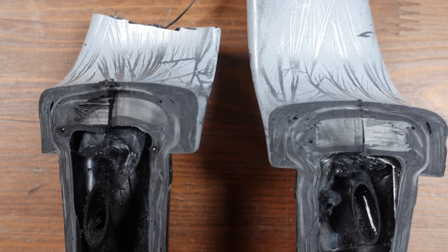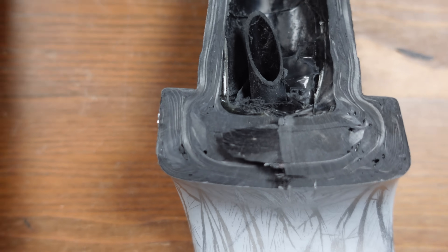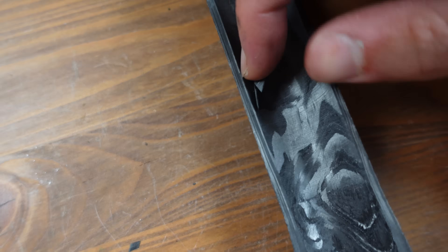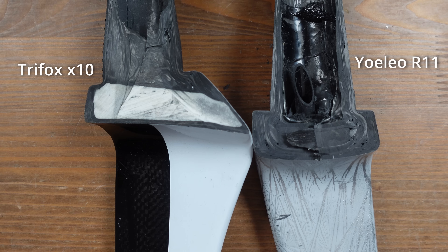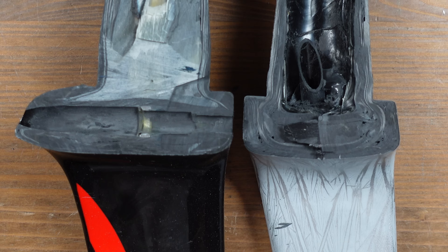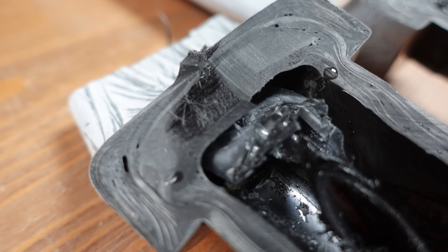Let's move over to the forks. The Yoleo R11's forks are looking pretty good. As this frame is disc brake, it's solid carbon all the way through the fork — no room needed for a front calliper bolt. You can almost trace the direction of the carbon curving around the crown race, which is noticeably thick. Inside the steerer tube there are some flaky bits of carbon — a random layer before the actual bonded carbon takes over. On comparison, the Yoleo forks are superior to the Trifox X10, which houses a mysterious white chunk — possibly resin — and bears a rather thin carbon layer on the outside. The Pinarello fork is wider, probably to accommodate the long bolt needed for rim brakes, yet in terms of carbon thickness around the crown race, both the Yoleo and Pinarello are in the same league. Rob said: the fork junction and crown race looks very solid — possibly overkill for a performance bike, but in terms of strength, really good.